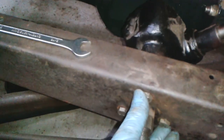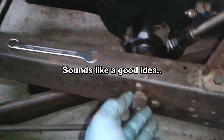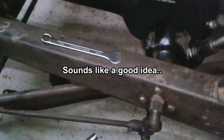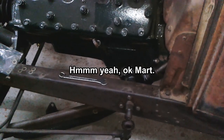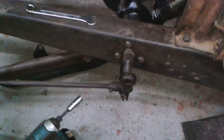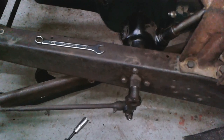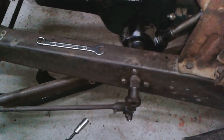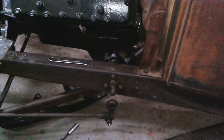I think it'll be okay. I could have achieved the same by leaving these without a washer and putting a washer behind just that one bolt, but having washers on all of them will allow it to pivot more readily and not try to bend stuff. Ideally you'd want the flange at the right angle with no washers, but this one was a little bit out. Just a quickie - thanks very much for joining me in the garage, catch you on the next one, bye.